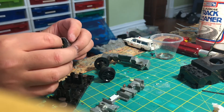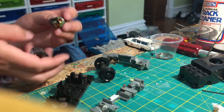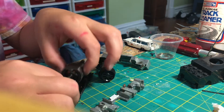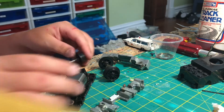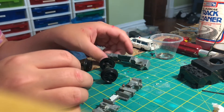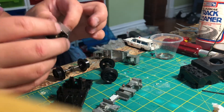If this motor does not work, you can find replacements online. Here's the assembly of the motor on the inside — my motor looks pretty good, so you can just plop that right back in. After that you're going to want to take off all the gunk from the wheels; there's normally a lot of hair and stuff. These three things will help you a lot: testing the motor, sanding the contacts, and removing the gunk. The last thing I did was put some lemon juice on the contact points, and that helps get rid of any extra oxidation.